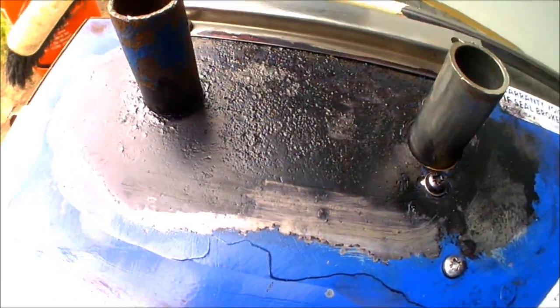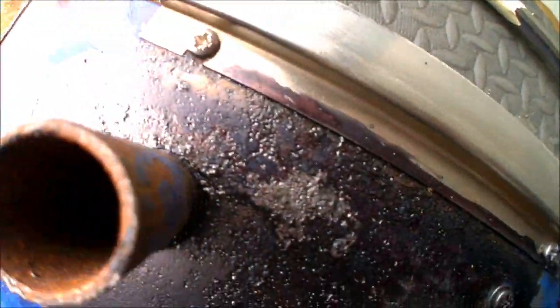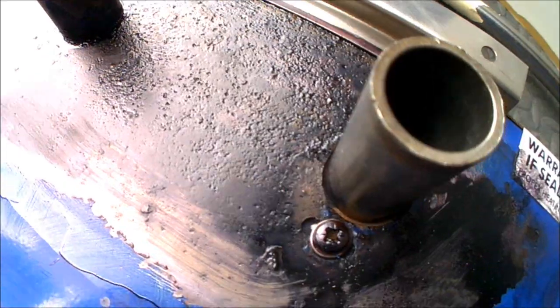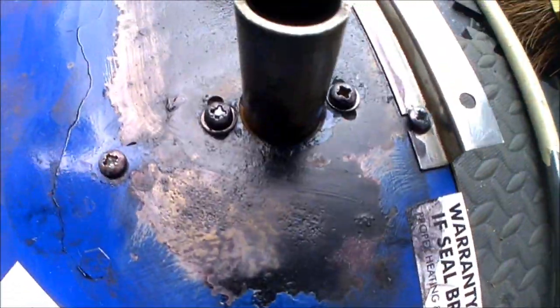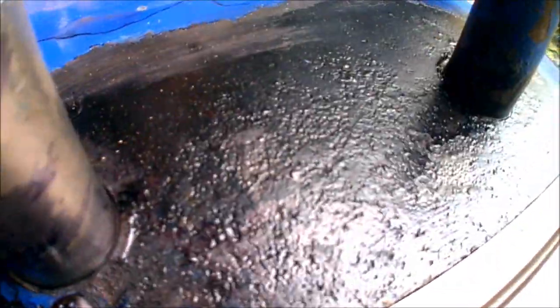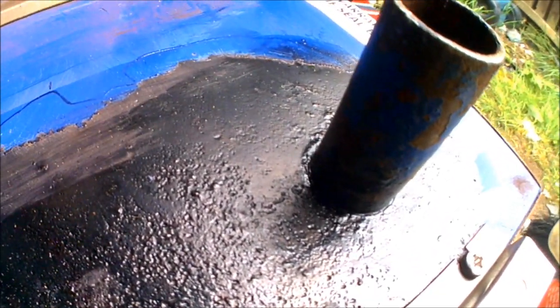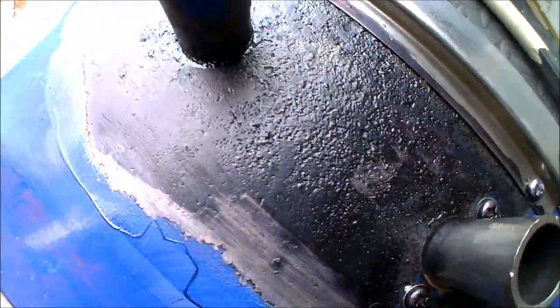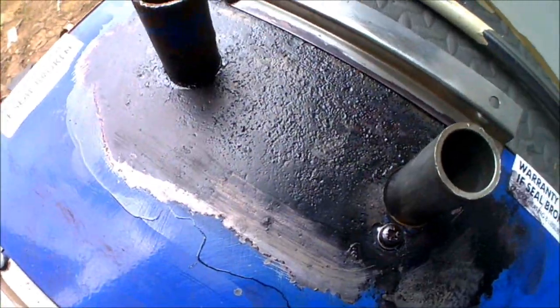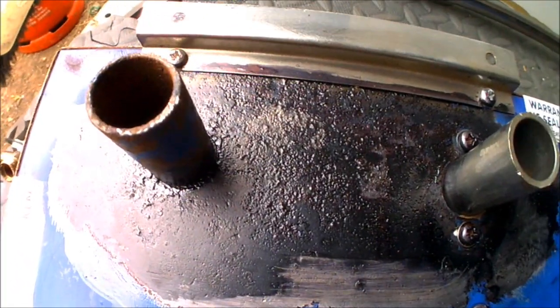So that's the Hammerite Krust that's been left to dry — it's been drying for over an hour now. You can see how it's turned fully bluey-black where it came into contact with any sort of oxidisation in the metalwork. That's going to give it a nice protective layer all the way around where I've ground back with the wire brush to as bare metal as I could get. There shouldn't be any further rust trying to bubble through in any of the treated areas. Now this is ready for paint, so I'm going to give it a quick coat of Hammerite on the bottom. I've only got black Hammerite, but it doesn't matter because it's going to be the base of the unit and not visible.